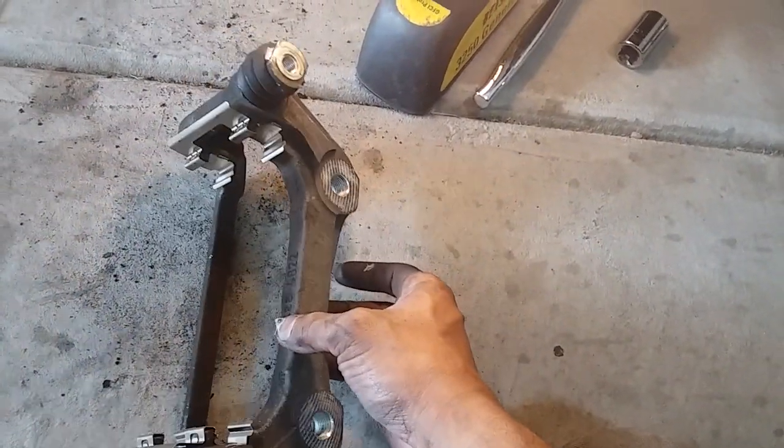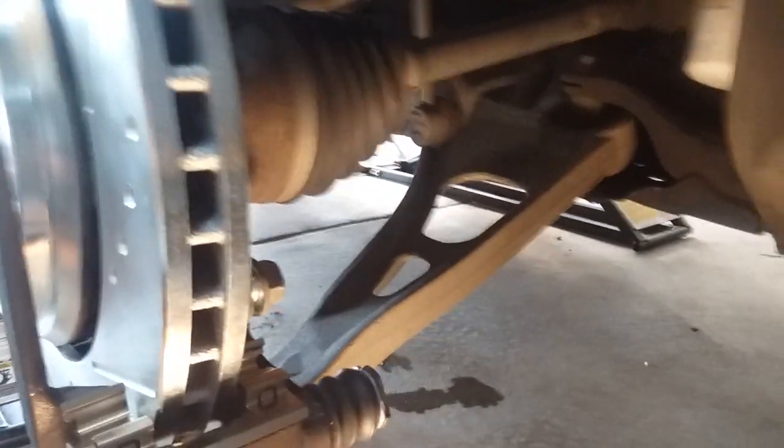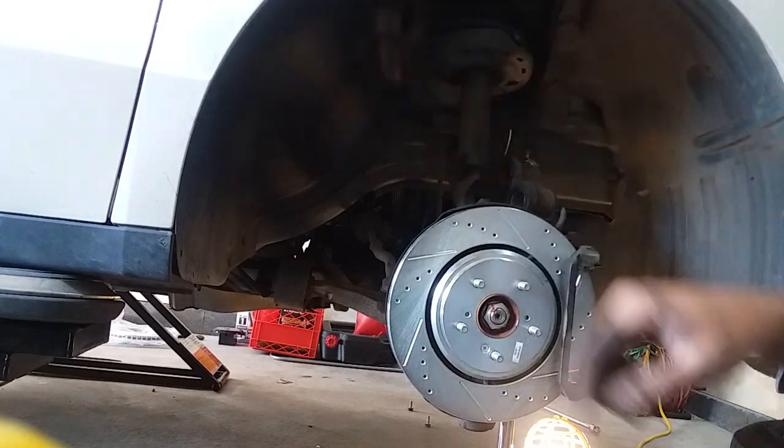So the tool's out. I'm going to put the bracket back in, then we'll do the pads and then the caliper. We're going to tighten the bracket back in at 95 foot-pounds. Got the torque wrench set up.